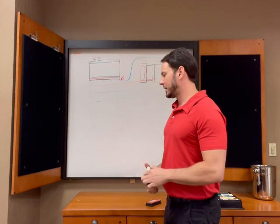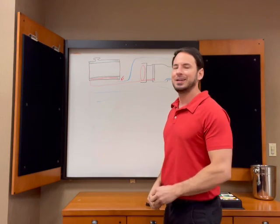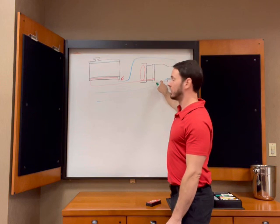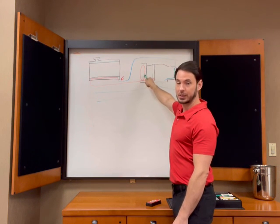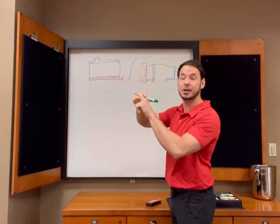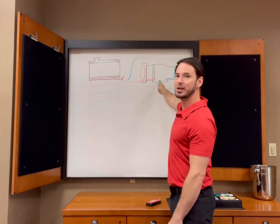Then I jump on the forum and somebody says, man, my ATF is 230. I saw it reach 240 the other day. I'm like, no, it's not. If your transmission fluid in here was 240 degrees, you'd be in big trouble. You'd be boiling fluid in here. Trust me, on these transmissions, you'll boil fluid. You'll spit the torque converter seal out because it'll seize on the torque converter that will be glowing red, and you'll spit fluid out the vents. You don't have anywhere near that in here.